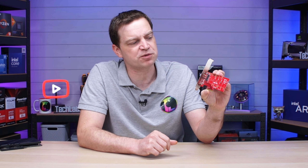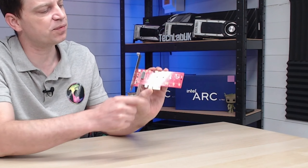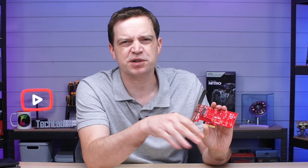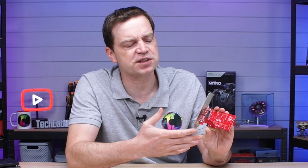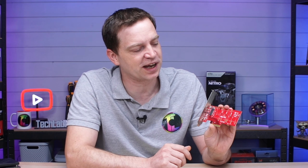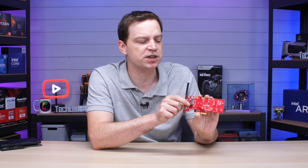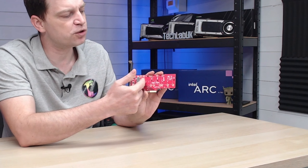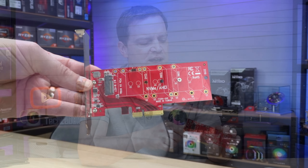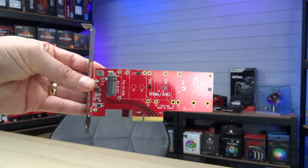For those of you that don't know what this actually is, this is an M.2 expansion card. You can pick them up for pretty much the price of a bag of chips. This one here extends your PCI Express slot to an NVMe slot — it basically just adapts it to an M.2 using the same protocols. You can include these in your spare PCI Express slots. This particular one is a very budget option at around four to five pounds, and it only supports a single stick — you can go up to two terabytes on one of these.